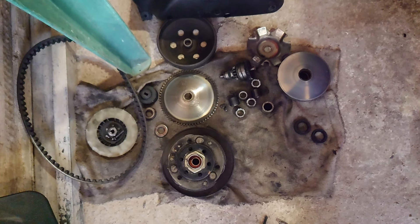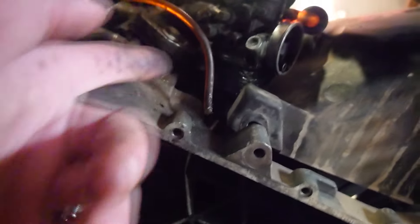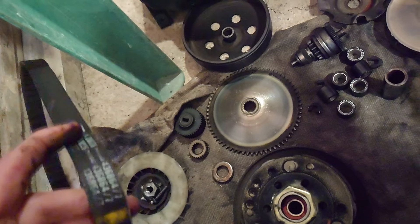It's bad service, zero tuning, no clue what's going on — you just buy parts and think your bike is fine until you bring it to me. With oil seals leaking, a carburetor that needs cleaning, a broken oil hose, and an oil pump issue, there is no way to tune a bike. We also don't know yet if the cylinder is damaged — the belt at least is okay and fairly new.